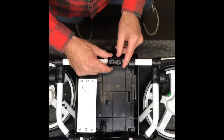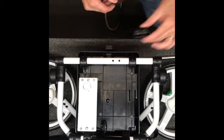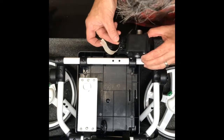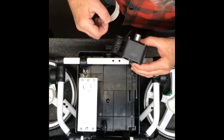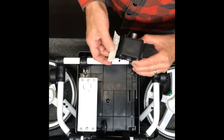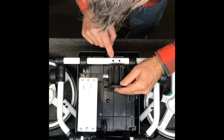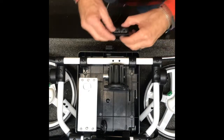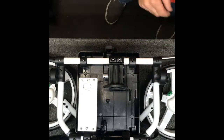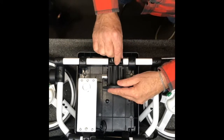This little piece you're going to reuse, so when we install the new gearbox we're just going to use that same one. This is the new gearbox that we're going to put on the cart. On the underside, these nuts fit into the cavity there. It's a good idea to put a little piece of tape over them to hold them in place, because they're a little tricky to hold when you put the screws in. This fits underneath the bar and lines up with these holes. Then you take that other piece, sit it in here, line it all up, and reinstall the screws — line them up with the nuts and tighten everything up.